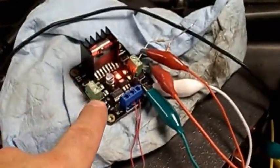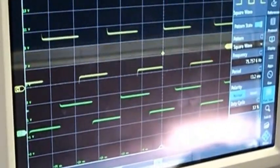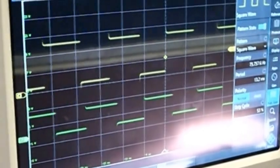Here's my setup. I've got a power supply underneath here, a motor controller to control the idle control valve, and my scope showing two waveforms. The top one is the ECU and the bottom one is from the scope signal pattern generator. The top signal is actually connected up to the connector where the idle control valve used to be, so we can run the valve off of the ECU or from the scope.